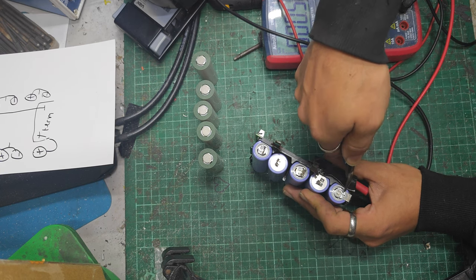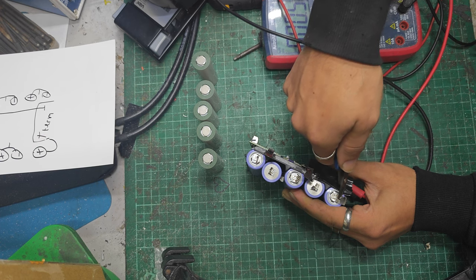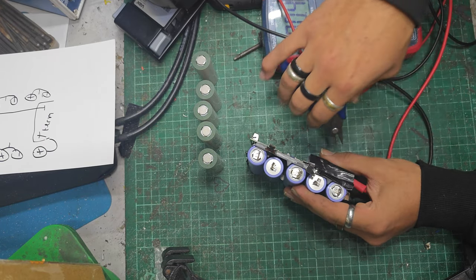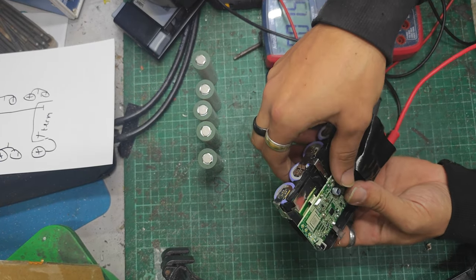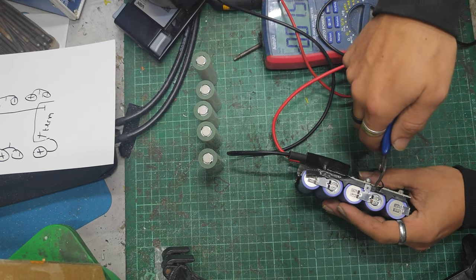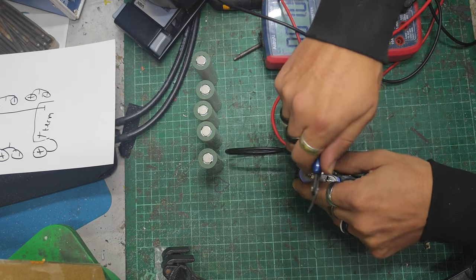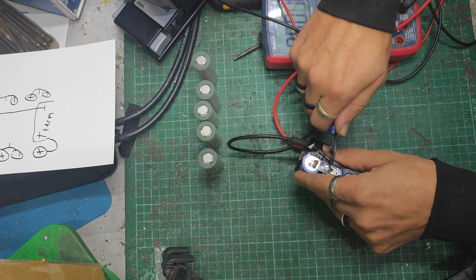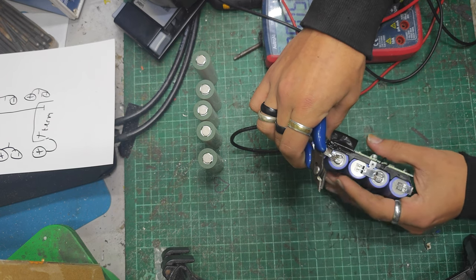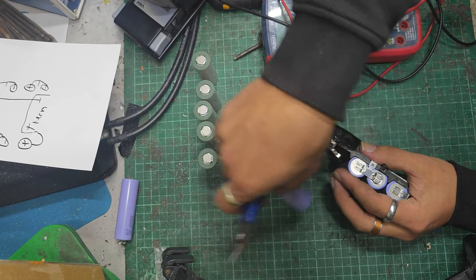And then, where to cut you? If I can cut you in a similar place, it'd be great. Without shorting this cell out. That's one side. I love it when there's only five cells. It's dead easy. I'm glad for the tape. Very glad for the tape. Power supply is still drawing a tiny amount of current. That's great. Goodbye, first cell. And second cell.